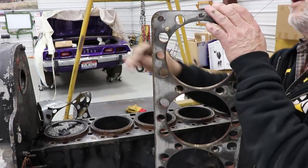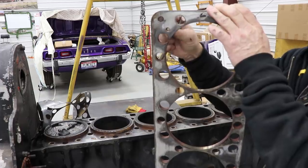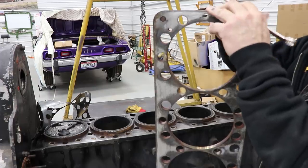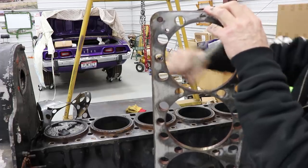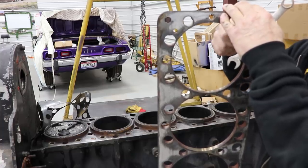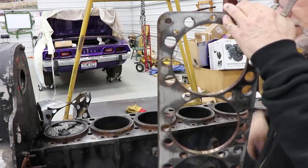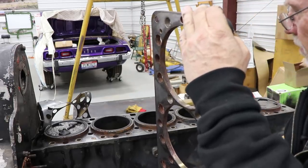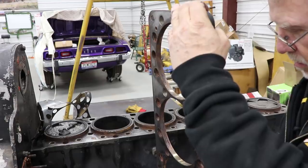So Bruce was here and we were talking about DI. He asked me how much boost I was making with this, and it would bury the boost gauge at 30 PSI. He got out his calculator phone and ran a little what-if, turned it around, put it in my face, and it said 583 on it. I believe it — a C15 didn't have anything on this old girl. Anyway, that turbo that was on it, that old Garrett T18, was not supplying enough air, and I'm sure that was part of its problem. Not enough air to burn the fuel.